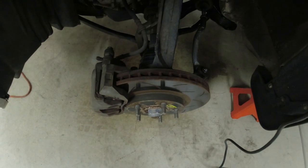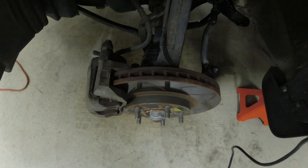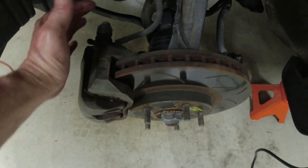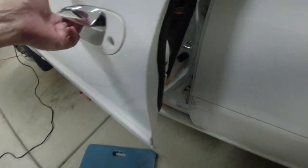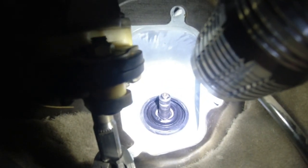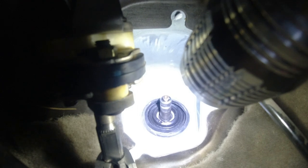So get both front wheels pointed as straight visually as you can. And then this will be the toe adjustment. So I think the toe might be off just a tiny bit. That's why we're going to go get an alignment. So you could just grab it and position it, and that is going to move the input shaft. So if we go inside and look at the input shaft, we can look for our center mark. And you can see it is horizontal. And now we could put the steering column on that input shaft. That's what we were after.